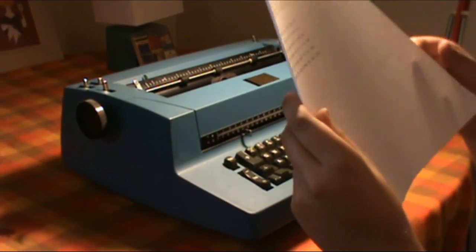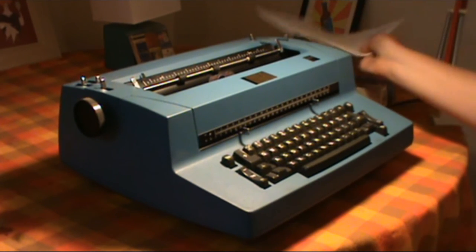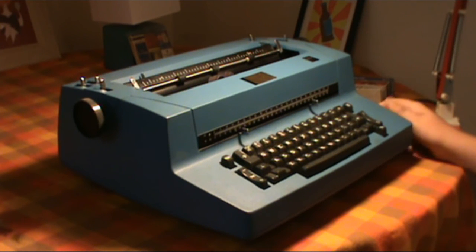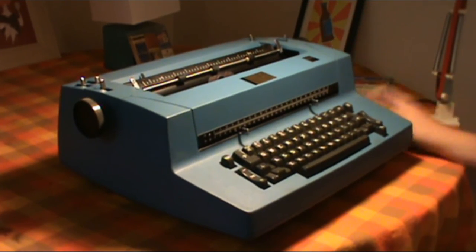You can see that because of the worn-out gears it already doesn't advance as it should. I did some research, and to replace the pulley would cost about $15 in parts and then approximately $30 in shipping, which I find ridiculous. The worn-out gears are about the same cost. But there are more plastic parts than just these, and they are just as old as the pulley, so it's likely something else will go too. Investing in this, I think, would be a bottomless pit.